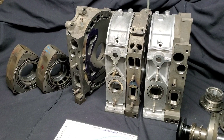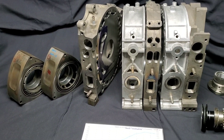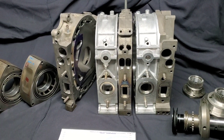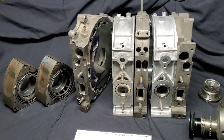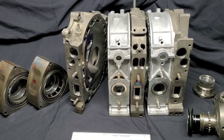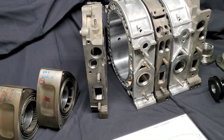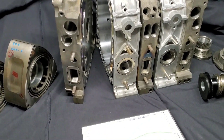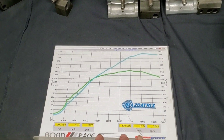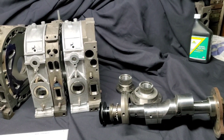It'd be interesting to overlay this with a modern turbo, some modern tuning, and maybe ethanol, because I think you're going to come up with more horsepower and definitely more torque with the increased timing you can run with higher octane. When you're looking at horsepower numbers per boost volume, I compare this in efficiency to other available turbocharged rotary combinations. The Renesis was never intended to be turbocharged, so to be able to create a package that works with turbocharging — that has efficiency and the ability to last under performance conditions — is a great thing for the Renesis. Here was a very successful package that we put together and raced, and you can see how it worked right there.